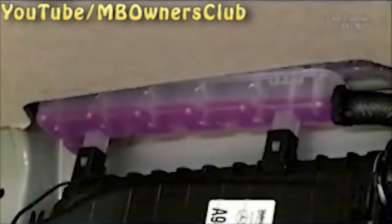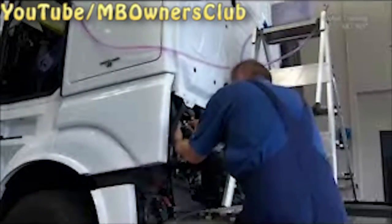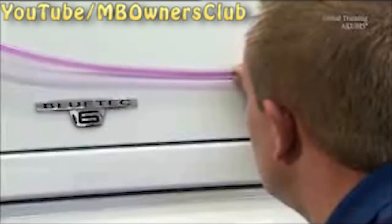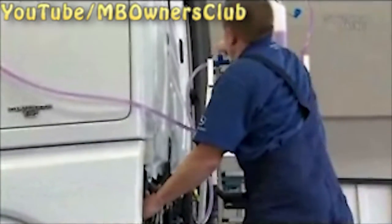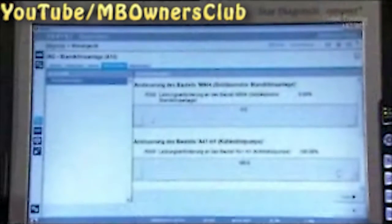Wait about 1 minute until the return line is filled. Meanwhile the liquid level falls in the tank. The process begins again — we call this procedure 2. Close the return line with the clamp and turn the coolant pump on. Now open the stopcock and wait until the refrigerant flows free of bubbles. Then close the stopcock and loosen the clamp on the return line. Let the coolant pump run for another 2 minutes, because now the refrigerant circuit is bled.